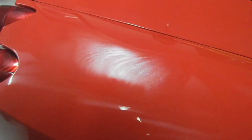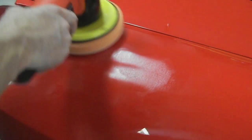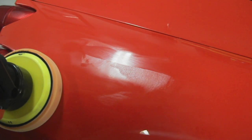I always stop it on the vehicle. It leaves a little spot, but it's certainly better than flinging it off. So you noticed what I did was first I sort of spread it around. Then I started going in a standard pattern like this. I'm working a very small area. And then when I'm done with that, I go back like this, basically doing about a half coverage of the previous lap each time. And so that's pretty much how you put the polish down.